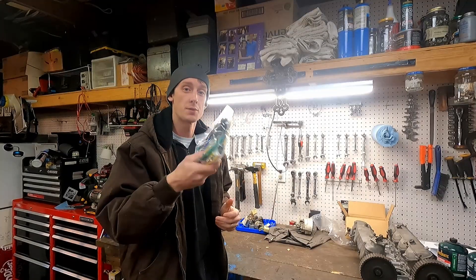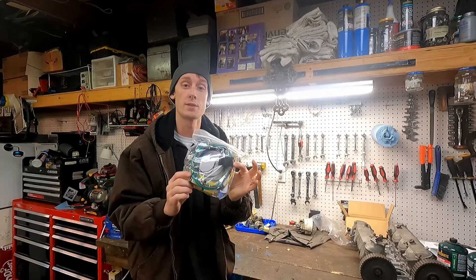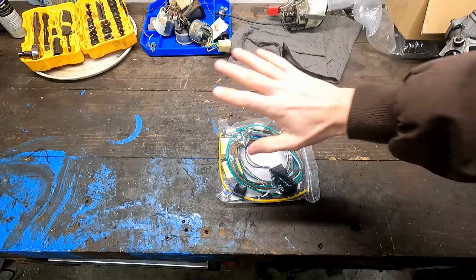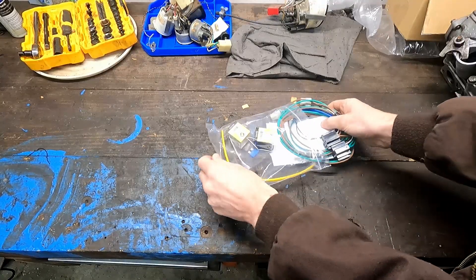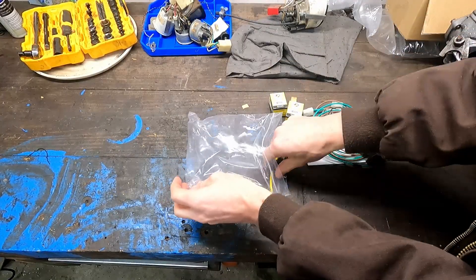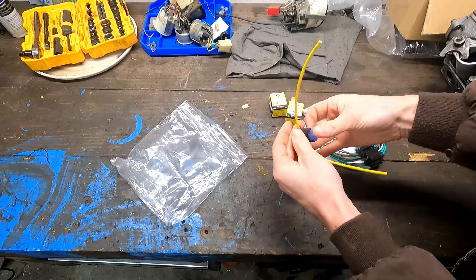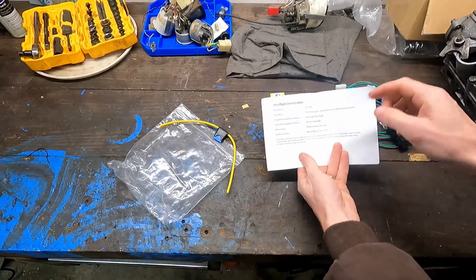The second half of this video is installing our headlight relay kit, available from VicAuto.com - I'll drop a link in the description. It comes with instructions - a really simple one-page guide telling you exactly where everything goes. Opening it up, we've got two relays, an inline fuse - a modern 15-amp fuse, way easier to deal with. The instructions show: black to ground, blue to power using your starter bolt or any 12-volt source, the long green and brown wires go to the passenger headlight, the short green is for the driver's side, white wire goes to the harness back to the firewall, and the red fuse holder you splice into the power supply.